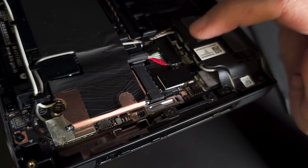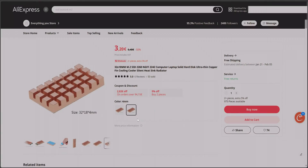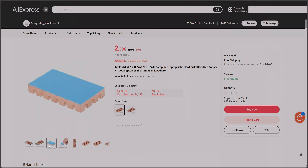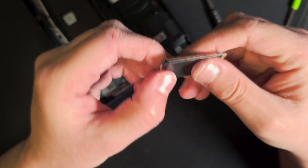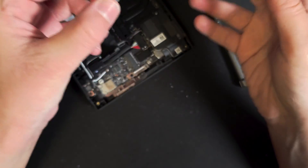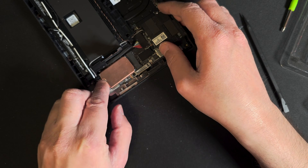We need something like 4mm or even 2mm in height for it to fit. I also tested other copper heatsinks — even a 7mm tall one — but the back cover still wouldn't close. I've already ordered some from AliExpress, so once they arrive I'll share whether they can fit and show the thermal results, so stay tuned. For now, the only one that didn't cause any issue was the slim copper one. Let's hope it can deliver decent thermal reduction — we'll test it now to find out by how much.